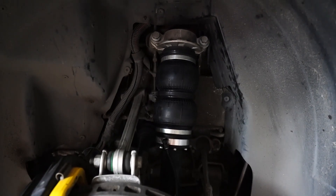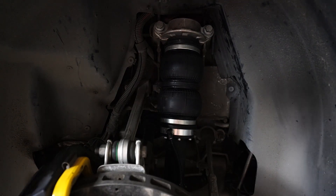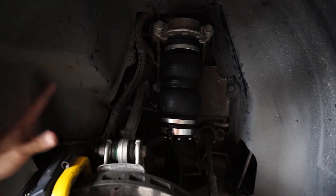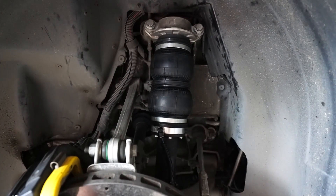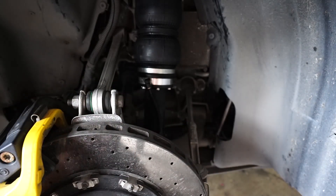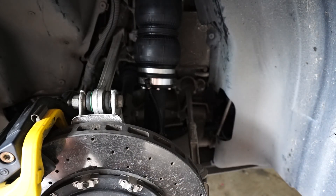Hello and welcome to the rear suspension of the Ferrari 488 GTB. As I said earlier, the front suspension is the same as the Ferrari 458 — a double wishbone. The rear is actually a multi-link suspension, which is simpler than the front. We just have a simple toe arm here and a tie rod. By the way, the 488 and 458 Ferraris have rear wheel steering. We have a tie rod here so we can actually adjust the toe on the tie rod without removing every panel on the underbody to access the eccentric bolts. You can adjust your toe right here on that tie rod itself.